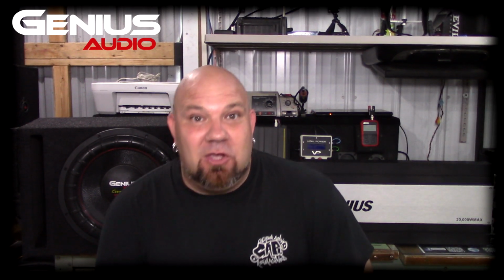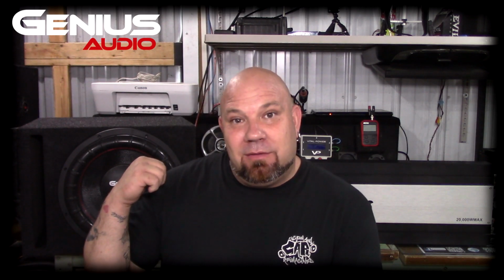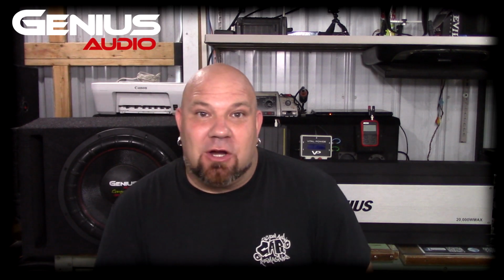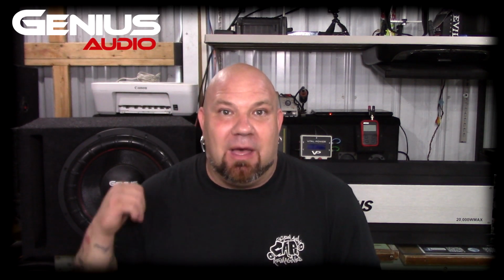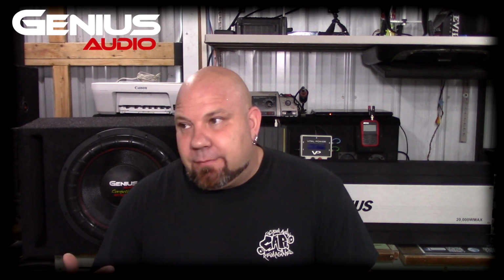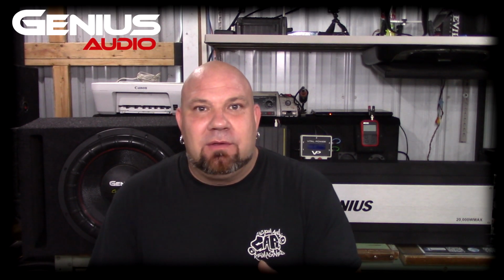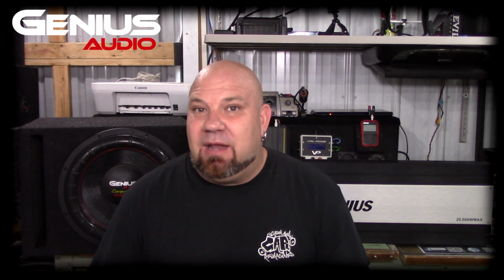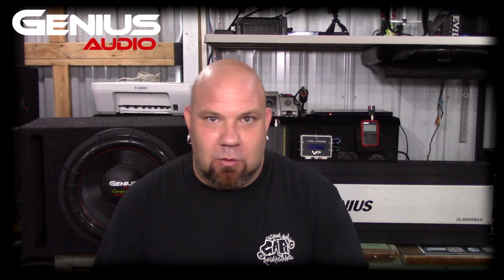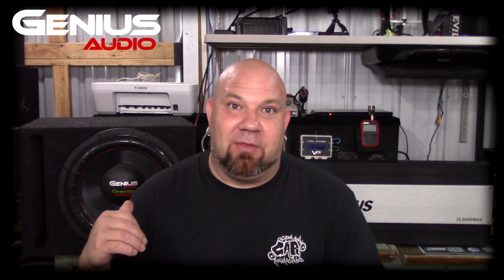What we're going to do in this review is 2 product reviews. We are going to burp this 15 off of this amplifier using Term Lab to see what kind of output I'm getting from this 15. Now, a single 15, if you're getting in the high 130s, low 140s for a daily driver, that's pretty damn loud. Now, DB drags, people will be talking about, you know, if it ain't 150 or 160, it ain't nothing. Fine, 2.25 cubic foot, remember that.